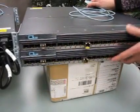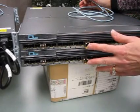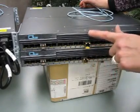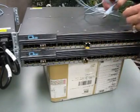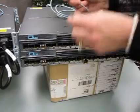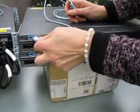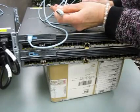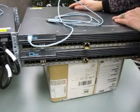One thing to point out: because some of these will be shipped to site already pre-configured, you need to install an SFP in the circuit interface before powering up the stack. If the circuit interface is port 12, which will be identified, then you need the appropriate SFP in place before powering up. Also note that Cisco no longer ships a console cable within each box — the new console cable style is USB-based. It's a mini USB connection on the switch side, and a regular USB that plugs into any USB interface on a laptop or PC. At this stage, we're ready to install our switch stack in your core.